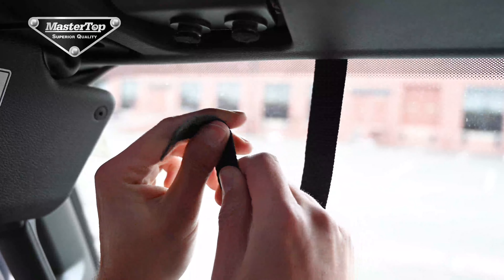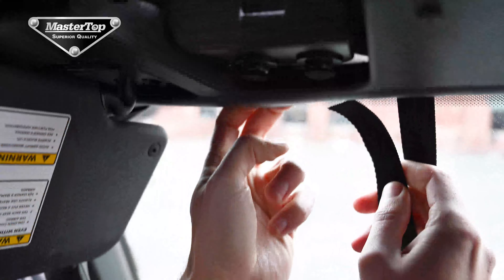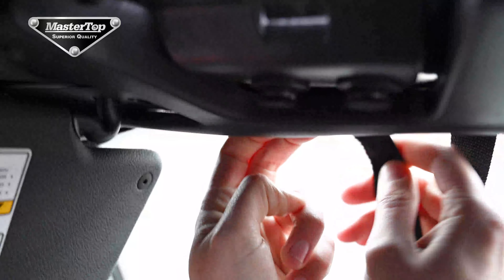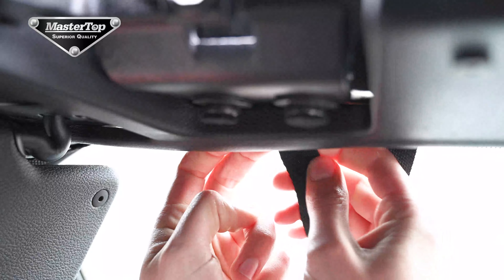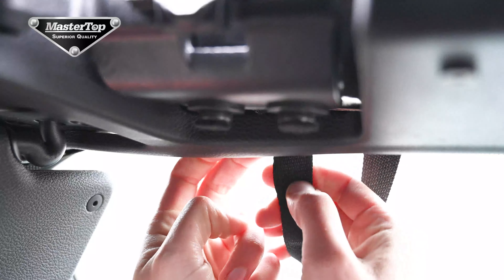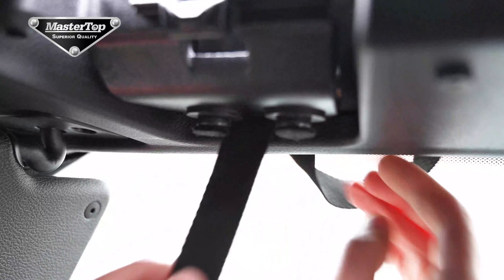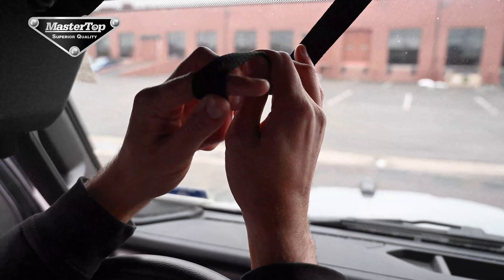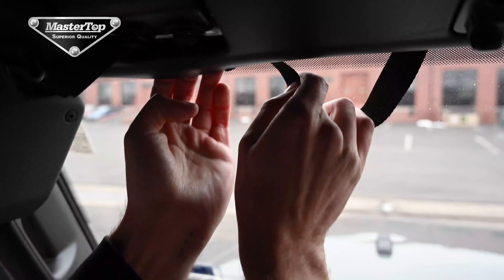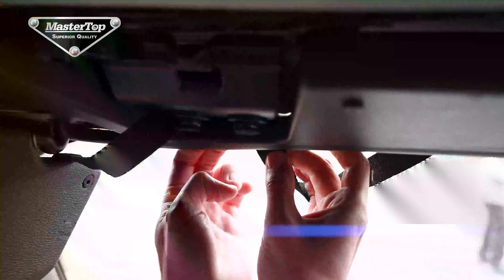You will need to make sure that the innermost straps are within the sun visor mount. Next, take these straps and loop them back through the front header trim of the vehicle and underneath the freedom panel locator. Again, you will need to curl the strap so that it can wrap around the trim and sit underneath the freedom panel locator.